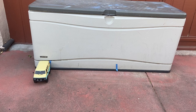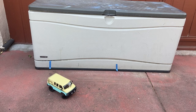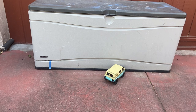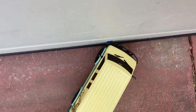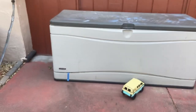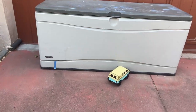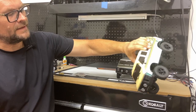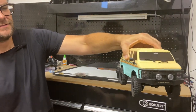I took it back in and had a look and discovered that one of the shocks I removed was put back in a different position — it was in a lower hole. So I moved it back, and now if you do the same test it comes back to the same spot exactly. It's funny how a different shock position affects the turning radius. We also have a massive spider on my van — yikes, off spider!